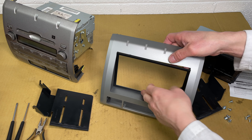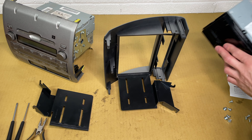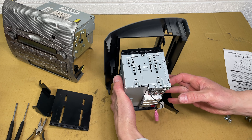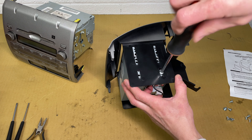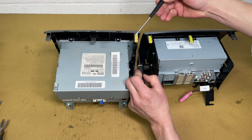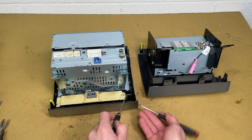Install the black plastic trim piece, then the plastic mounting brackets snap into place. You sort of have to juggle the side pieces and the radio at the same time so the whole thing doesn't just fall apart. Slide the radio forward to the right depth and use the provided screws to hold it in place — I installed three screws on each side with the machine screws into the threaded holes in the radio. I'll need to reuse these yellow snap things from the old radio. Gently unsnap them with a screwdriver and a pick from both sides and try not to send them flying across the garage. Organization is key here — if you have a mess, you won't find these little things when they take off.